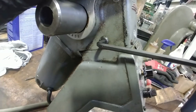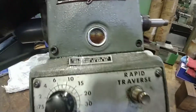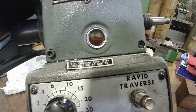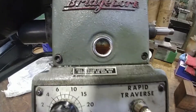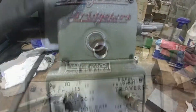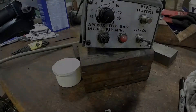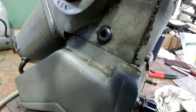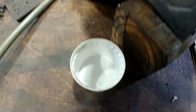Next up is draining the oil, whatever's left — if there even is any. Sometimes, as in this case, the sight glass gets so stained it looks like there's oil in there and customers don't put oil in. This one will get a new sight glass too, so I'll keep it tilted to one side with a little block, take out the drain plug, then tip it over and drain it into a cup.